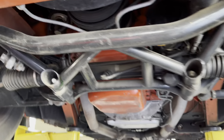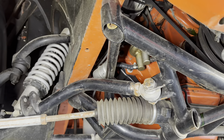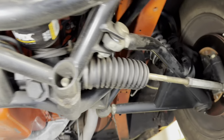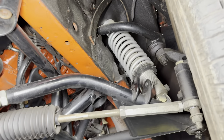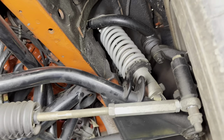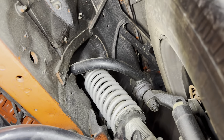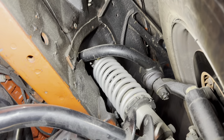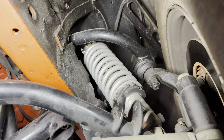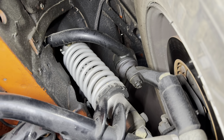Now we've got the underside. Apologies for the background commercials - they have the radio on. The biggest thing I'm concerned about is they've got a front tubular k-member with control arms and coilovers. I'll be honest, I don't like these. The problem is it's a coilover setup that goes to the upper shock mount, so all the load of the car goes to the shock mount. If you don't reinforce that upper inner fender area, it'll crack - it's not meant to take those loads on a Mopar.